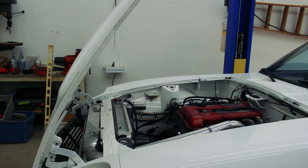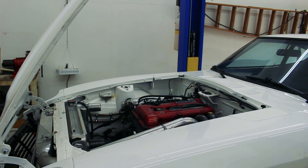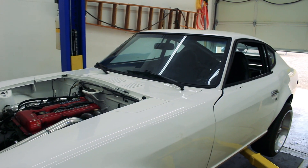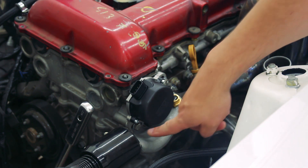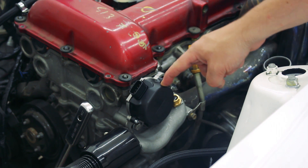The cam angle sensor, or cam position sensor as it is sometimes referenced, is a sensor used to directly interact with the cam position as it rotates using a gear at the front of the camshaft. This is done with a large shaft that extends into the timing chain area. The sensor is in the uppermost portion of the block just below the valve cover and is held in place by two M8 1.25 x 20mm bolts. There are Phillips screws located on each side of the black cap that retain the cap covering the actual trigger disk within the sensor.